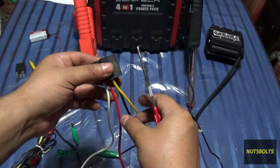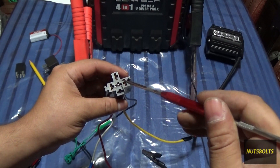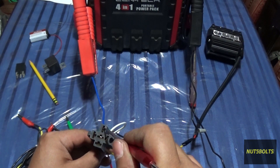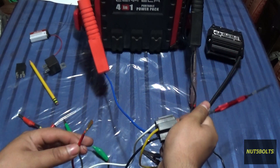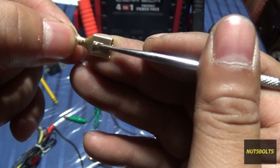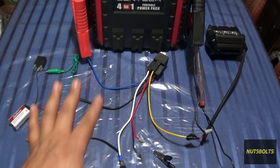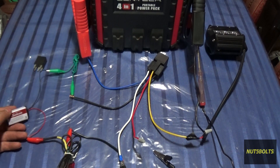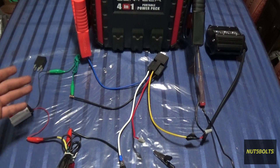If you're wiring your own relay and want to remove either 87a or 87 from the harness, you come over to the relay and look at these little notches. You stick something pointy — a small screwdriver — push in the little tab, and the whole terminal slides out. That allows you to remove the pin cleanly.